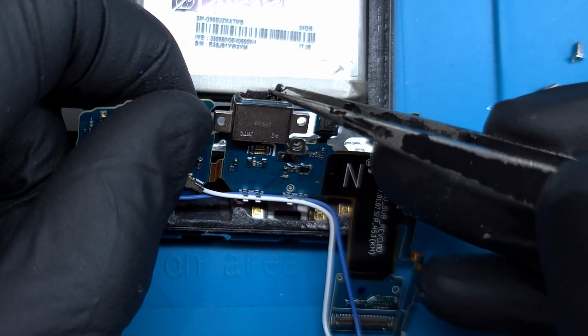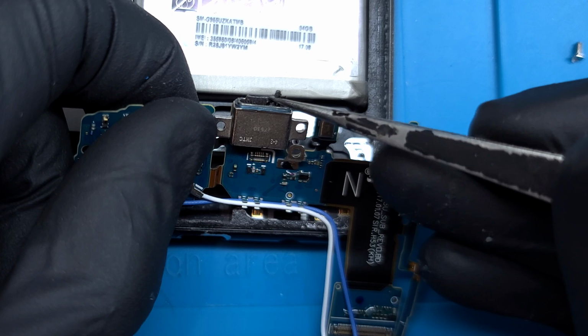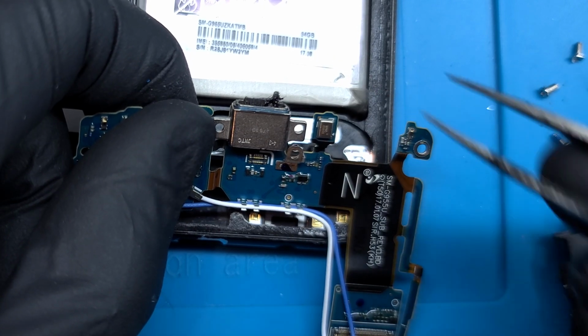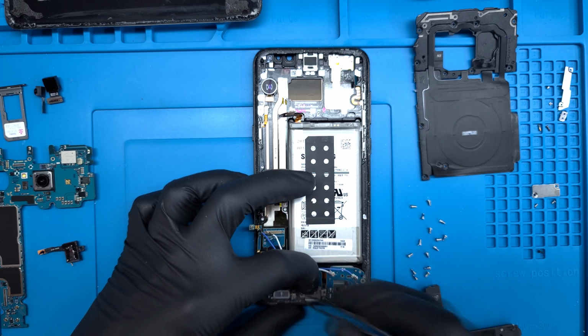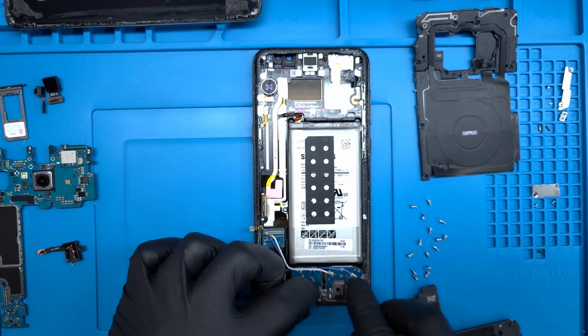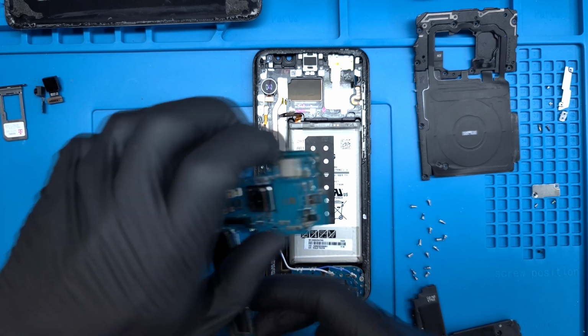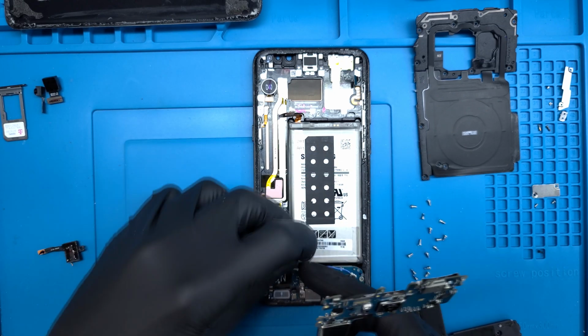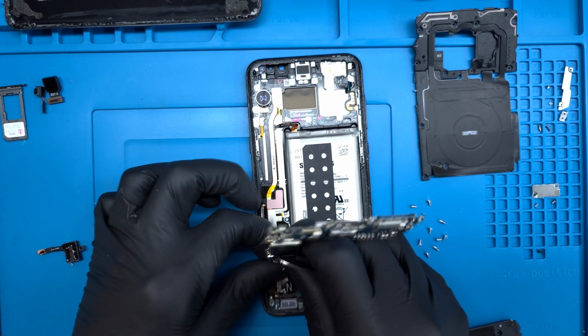It looks like some pins got crossed on the USB-C port, resulting in catastrophic melting and burning of the port when a charger was connected. I'll slip the new charging port in after transferring over the antenna wires. They need to be routed in a small trench cut along the frame just below the battery compartment. The Lego style connector can be bent upward so the main board can be attached.